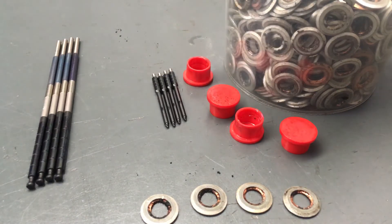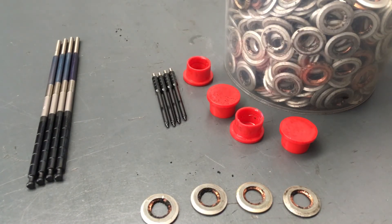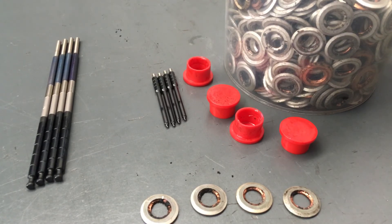That's normal — eventually it erodes away and thins out the meat you've got left to seal, but that's not usually what causes the problem. Now, these red caps — when I send them to you with the injector kit, don't assume they're clean. They could have come off new injectors or someone's old injectors. Give them a clean with carby or brake cleaner, blow them dry before you use them to cap your common rail.